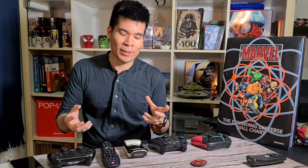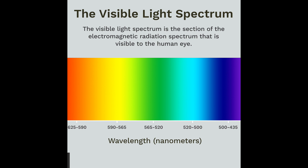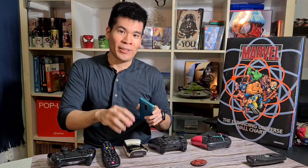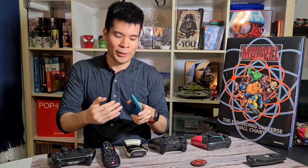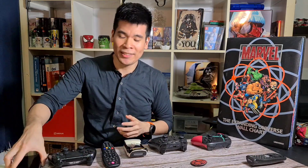Why this happens is actually simple physics. All around us there are different light spectrums with different wavelengths and frequencies — the ones we see are the visible light spectrums. These cameras are able to detect light that is not visible to the naked eye. What it does is pick up infrared light, also known as IR light, which goes through that semi-transparent cover and hits the sensor. The sensor picks it up in the color filter, it goes to the camera app and then to your eyes. So what you're seeing is actually infrared light.